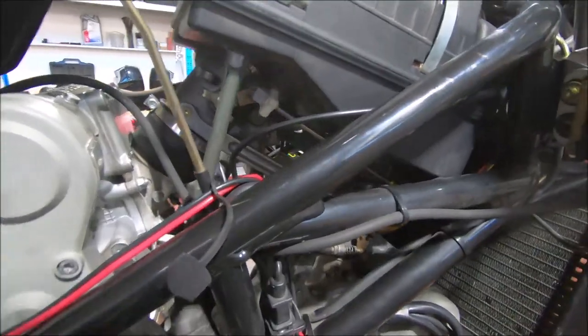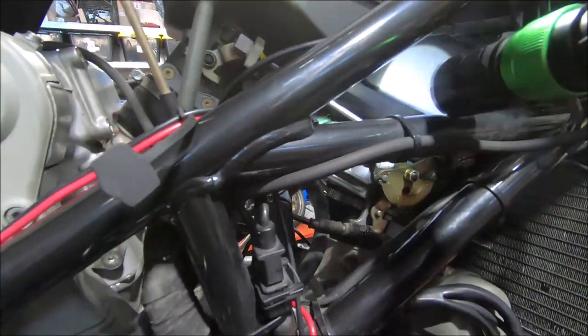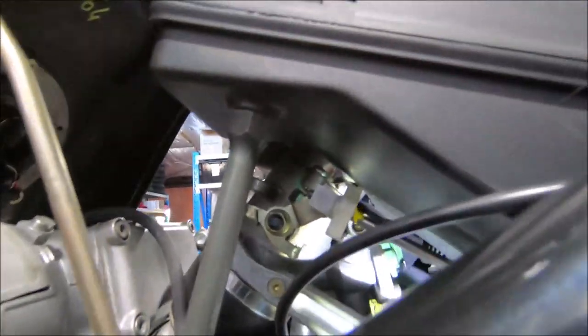The next thing we're going to adjust is the air bleed screws. There's an air bleed screw in there behind the throttle linkage. It's a little brass head screw. It's quite hard to see, but that's what we're going to be using to adjust the idle mixture and idle speed at the end. And the other air bleed screw, if we can find it, it's very hard to see with the airbox on, is up in there, just above the throttle linkage in front of the white thumb wheel. That's a vertical air bleed.